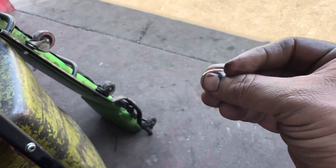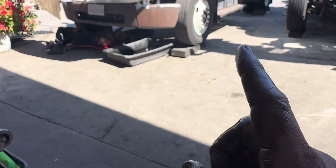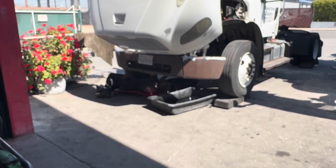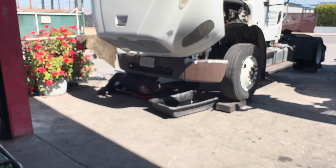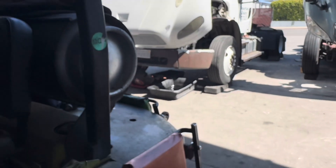And again, look at that oil itself — literally just wipe it right off, it doesn't leave any kind of residue. I don't think the issue is going to be down there. I think the issue is going to be up on top, possibly an injector issue. Truck has about 260,000 to 270,000 miles. Once Tony's done there and we get that stuff out of the way, we can both get in there and start pulling things apart.